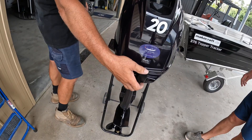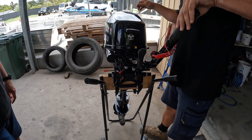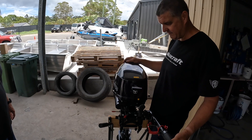There's a little catch on the back here. What we've been finding is some people are pushing on this part to lift the motor up, but that's not really designed for that — you can put your hand there and use both hands, but don't just push it down there. When you need to tilt the motor up, it locks there so you can tilt it up into the travel position.